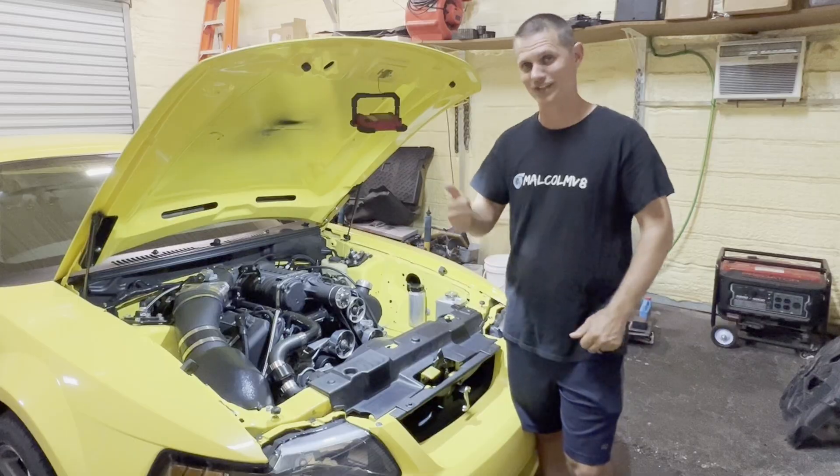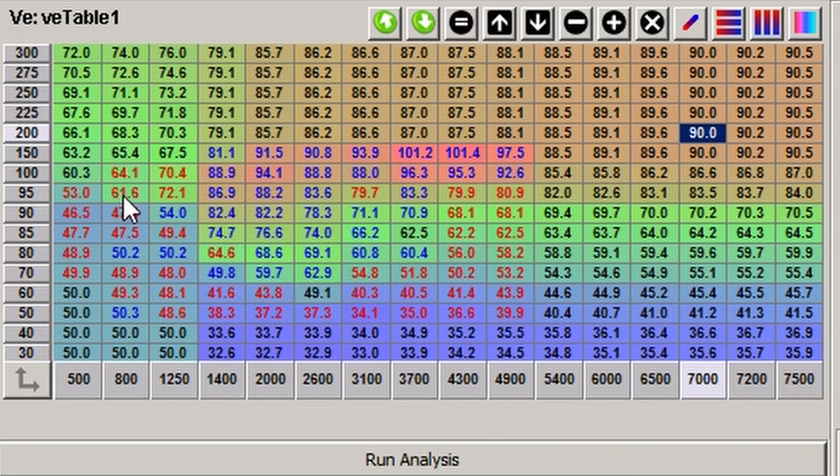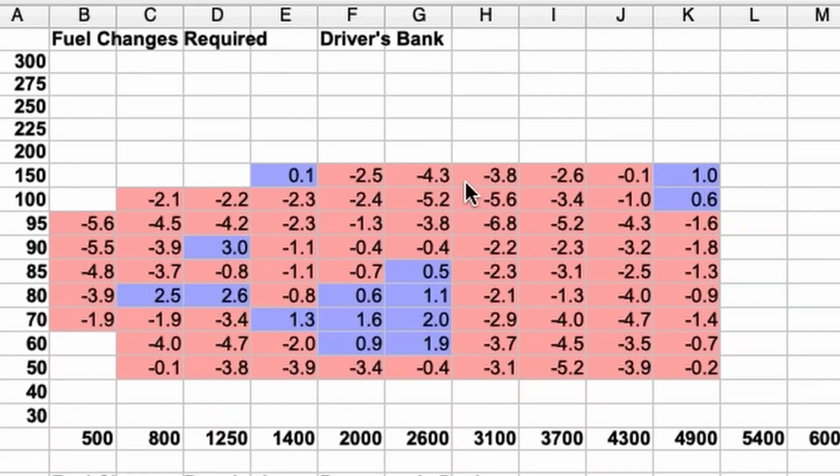Here we have his log, and I ran it through an analyzer to look at what's going on. This is thirty minutes long, driving various loads and conditions — not very high RPM or very high boost because we're just getting it dialed in. I put this data into a spreadsheet to look for a trend in the fueling. I have it colored red where it's too rich and pulling fuel out — you can see the negative sign — and blue is where it wants to add fuel. The overall trend is it's a little too rich.